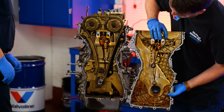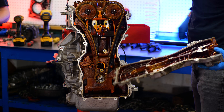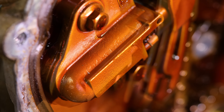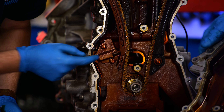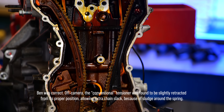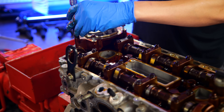That looks the same as the valve cover — even the guides look good. Even though the conventional had more varnish on it, wear was still really good. Performance-wise, it did start to get a little rattly at the end — the timing chain tensioner was a little stuck. I'm noticing it's caking up right on top of the tensioner and inside it too, which would start affecting its functionality. It's just caking up on top — we call that sludge. There's actually a sludge rating that you do on these. Does this look about what you'd expect for a conventional at this mileage? Yeah.